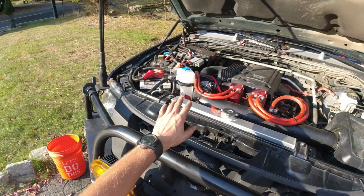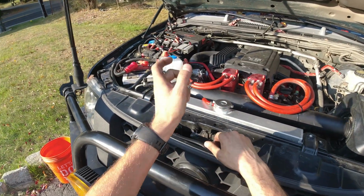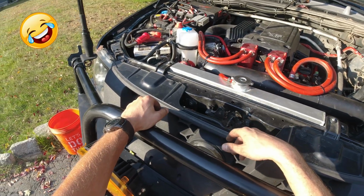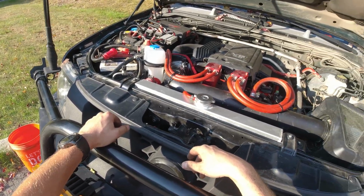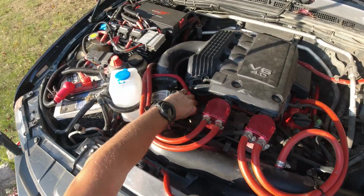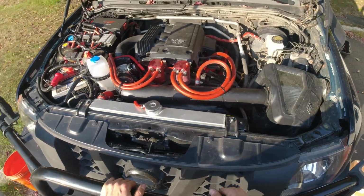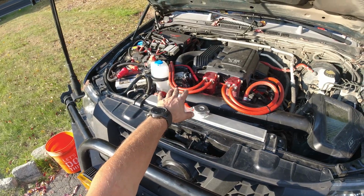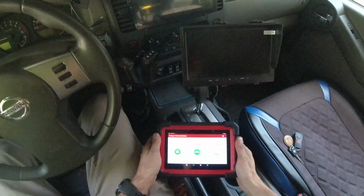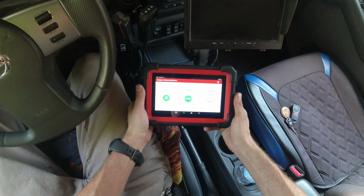Now you were probably telling me from the beginning, come on, use the extractor tool, use the extractor socket, but I didn't hear you guys. You gotta scream louder next time, all right? Oh wow. But I'm definitely gonna buy a bigger set now. So just gonna double check, make sure everything is in place, everything is nice, and relearn the throttle body and start it up.